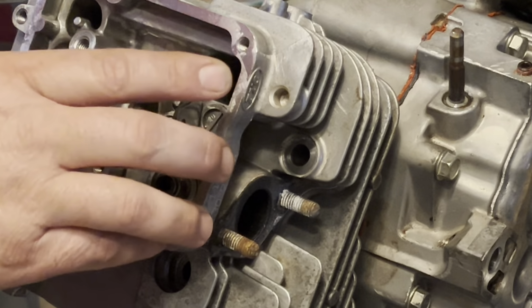we'll set it closed on the intake. And the way these work, they're a little bit different than a lot. This little bolt right here is just on a cam. Basically, you just rotate that bolt till you get the clearance you want, and that right there feels great. Hold that bolt where you want it, you run that jam nut down, and all that jam nut does is keep that bolt from turning. We're good there. So now, as long as that bolt doesn't turn, and it shouldn't, all you're going to do is snug up this jam nut, like so. Boom. Perfect.